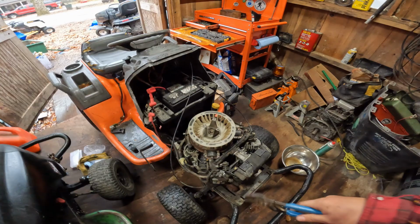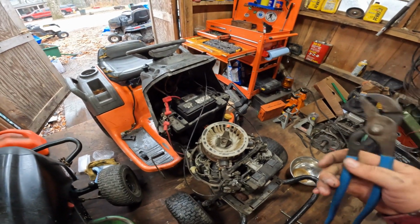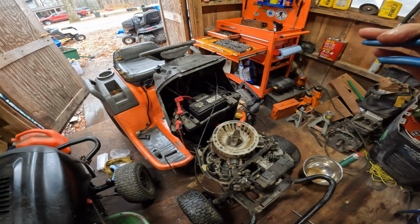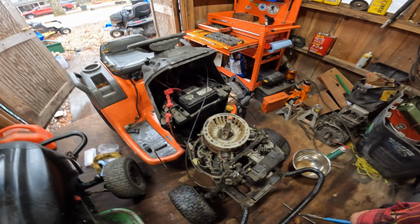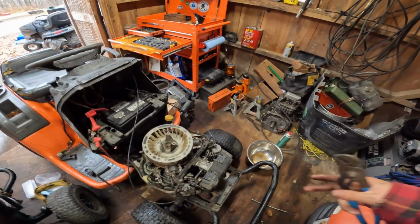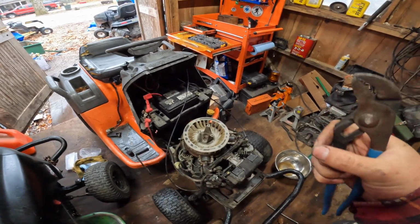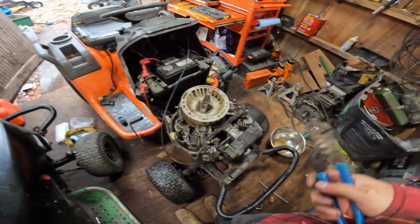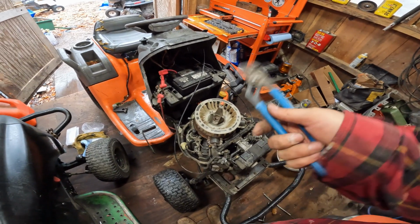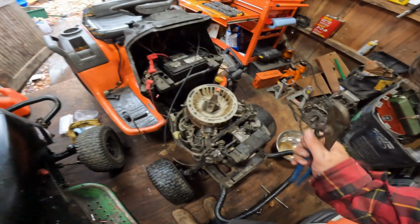And because I cleaned it, I just flushed the whole tank. Well, I say flushed, but what I did was I took the carburetor out, put it back in, and ran it for a long time, then took the carburetor out again and looked at it. It had a little bit of water, but not as much as before, which tells me that we ended up sucking all the water out. So there shouldn't be any water in the tank anymore. And listen to this now.